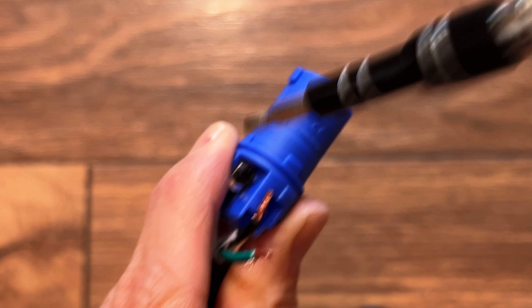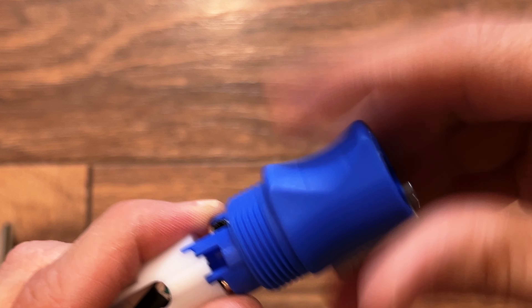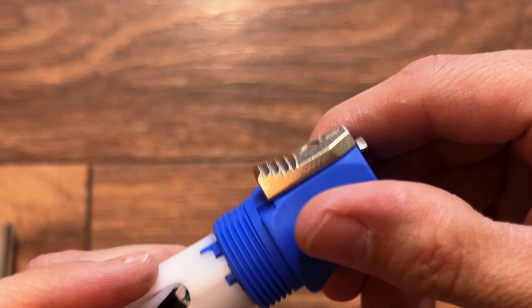The gauge is important because it depends on how much power you're putting through it. So if you were to run these little LED lights and you're running one, it's not going to be quite as important as if you're chaining a whole bunch of them together, because all that power is going to be going into one into the next one. So that cable is going to have to handle all that power. And it becomes increasingly more important when things have bigger draws like the speakers or subwoofers.